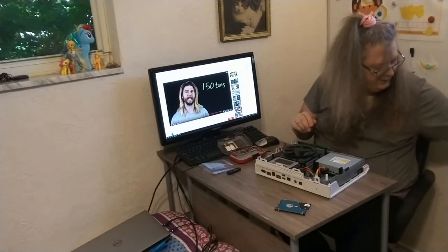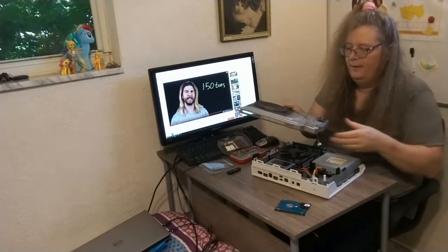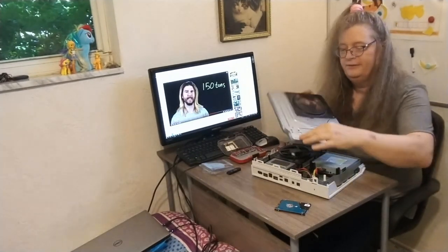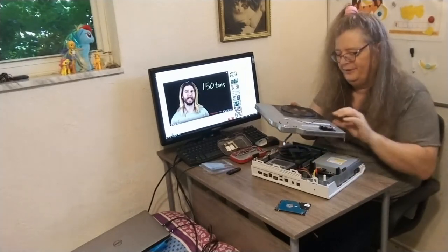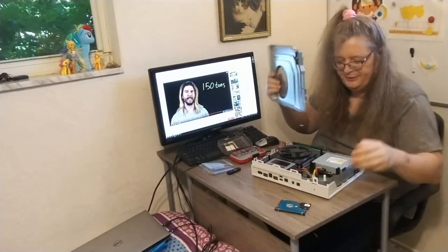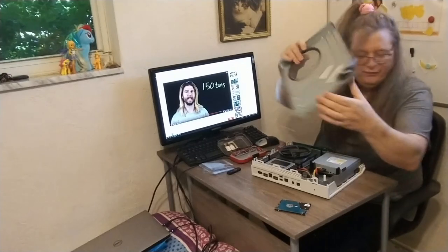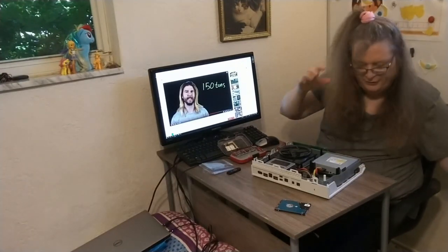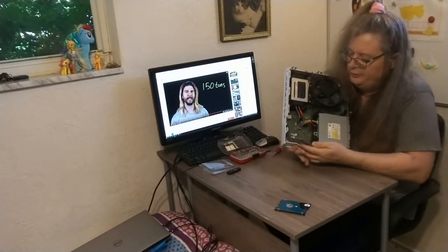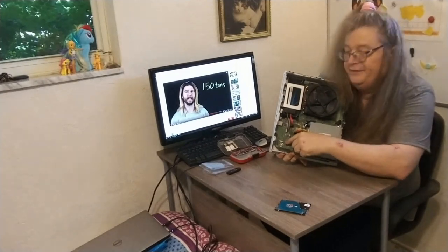And now we're going to take our top cap here, and remember how it was oriented? In this case, the Wi-Fi unit was here, the piezo speaker and the cable, and then the ribbon cable that clips in goes down here, okay? Again, here's the ribbon cable. I don't know if you could see that well before, so before I put it together, I'll try to give you guys a glimpse and show you. So here's where we want to connect it, right here. You guys can see right there, okay?